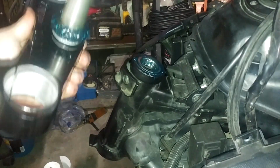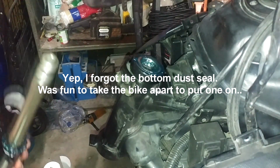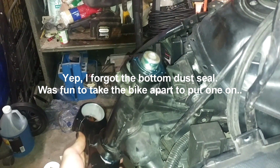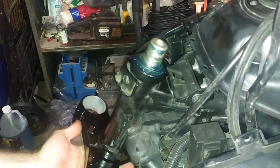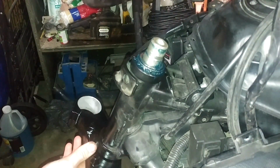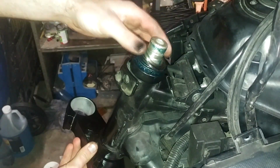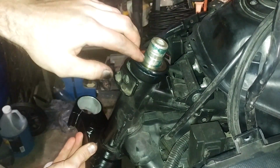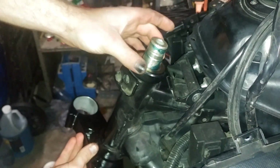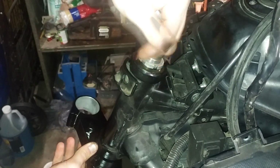Here's the top, or the bottom triple I painted, lubed up that bottom bearing. I'm gonna slide that in there. Yummy. I'm gonna try to use this bearing protector that came with the R6 or R1 parts, I should say. Oh yeah, it doesn't fit half bad actually with the bearing pressed down, but I'm just gonna put that there to hold it on,